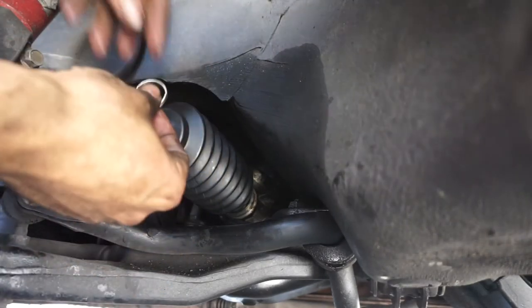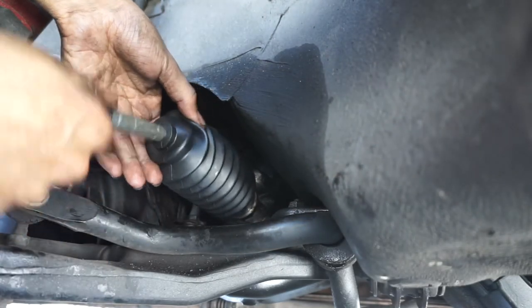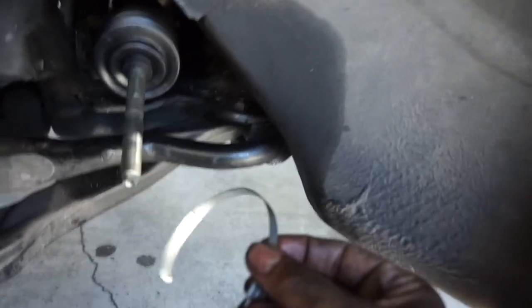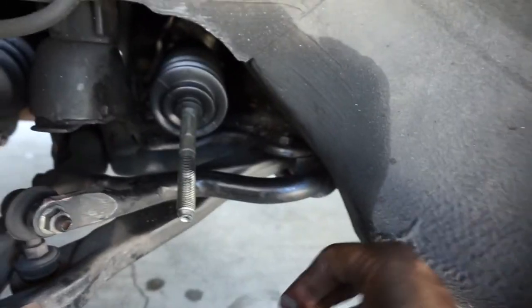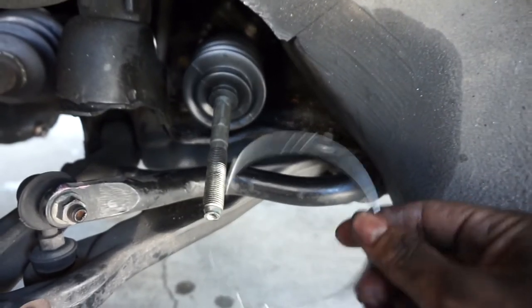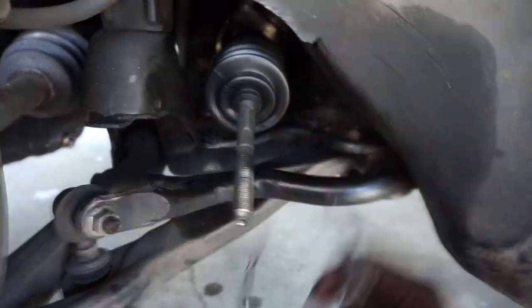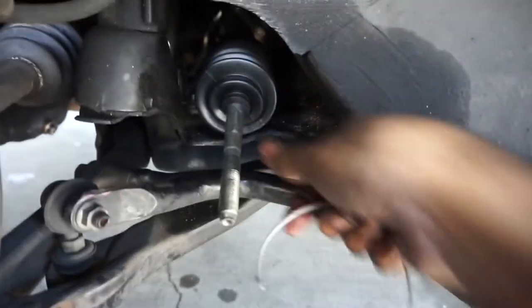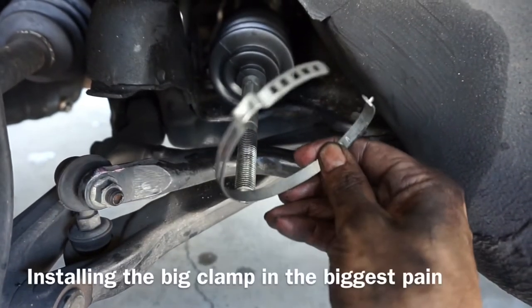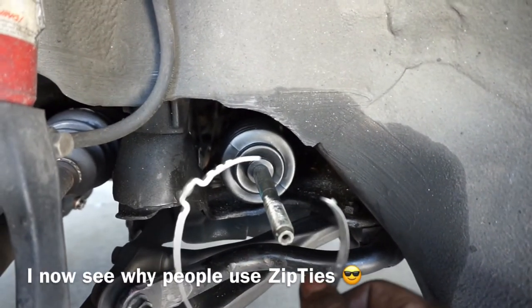There's going to be a little notch and you'll feel it settle in there, then push it all the way up. I ended up taking off the clip and spreading it out because with the clip pre-installed, since the rack already has a groove in the rack body itself, you can't really slide it on. So I took it off altogether, bent it out of shape just a little to go over, and then let it lock into those little clips. Overall it's installed and looking pretty good.